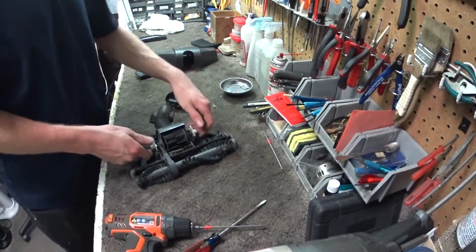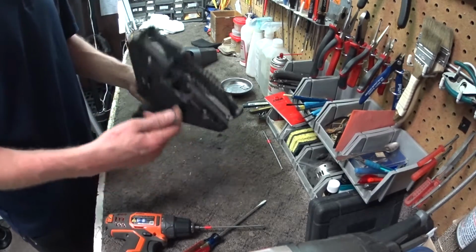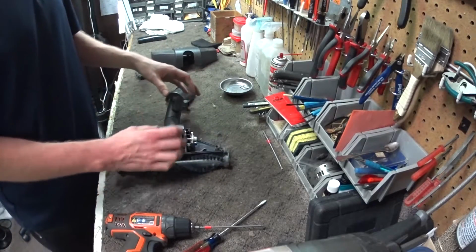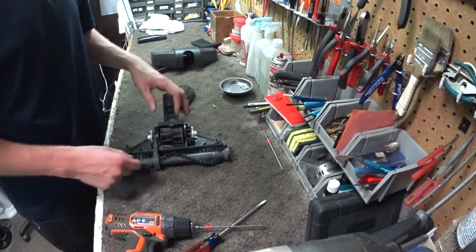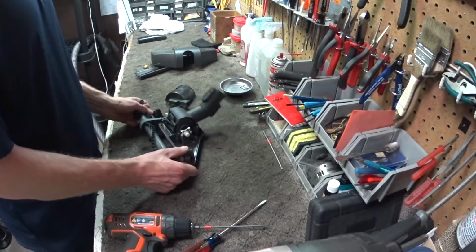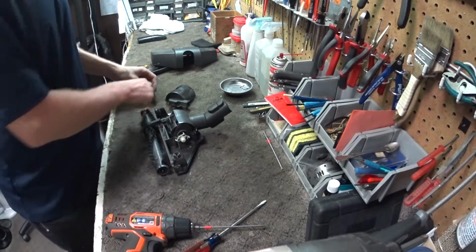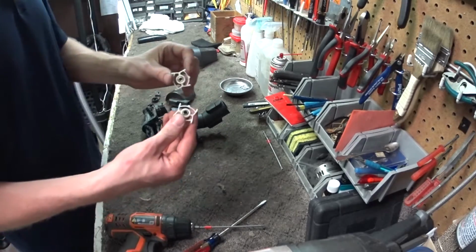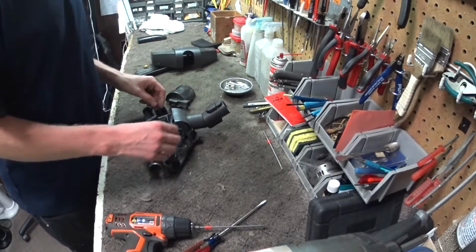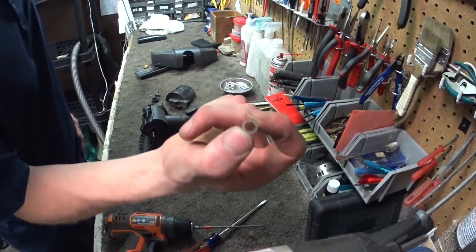Pull this out. You see the turbine, so as air spins through this little hole, the suction just drives the brush roller. So everything else just pops out of here. Interesting bushing designs. Again, these will need to be cleaned. There is one little guy who's not captive, and he's this thing.